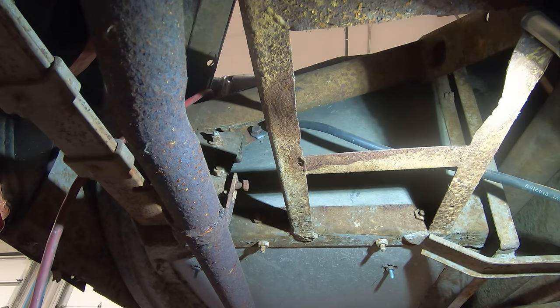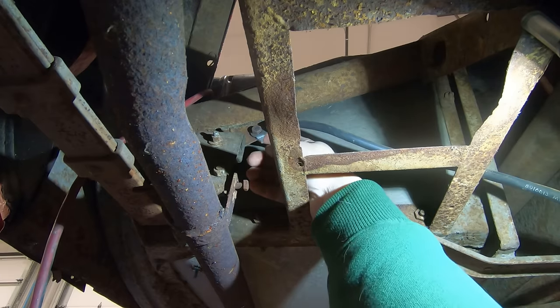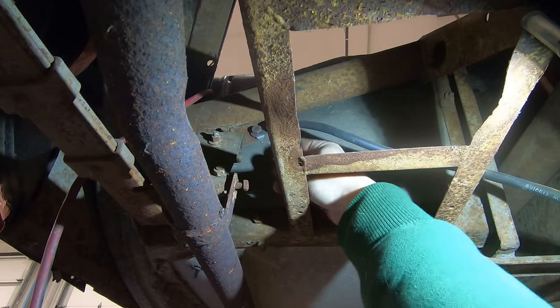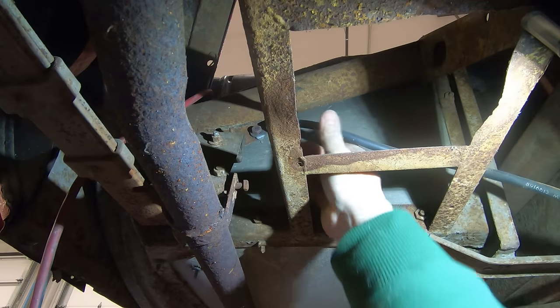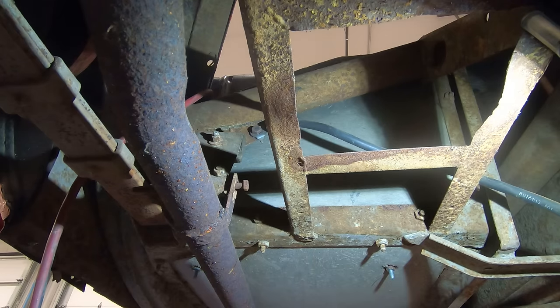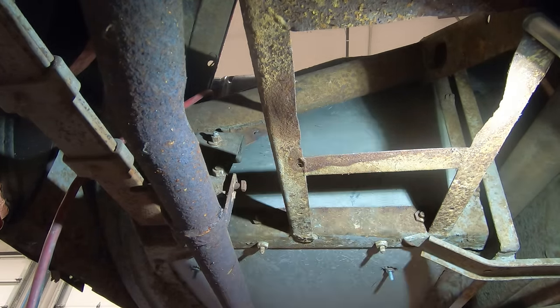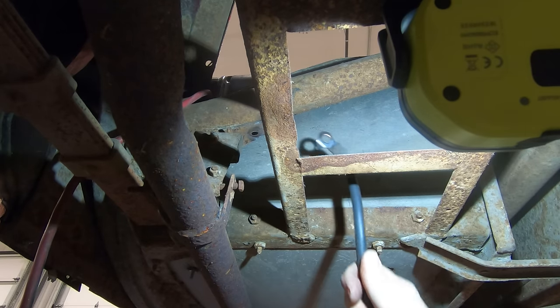Before I connect up the battery, I'm going to clean up the ground. You can see it's bolted to the frame right here — there isn't even a washer on here, so it's not making full contact with the connector on the battery cable, and it's loose. I think this is going to make a big difference in supplying power to the starter. I've cleaned the rust off and I've got a new bolt with a washer.